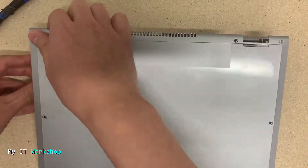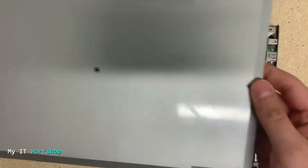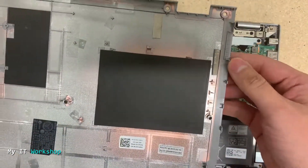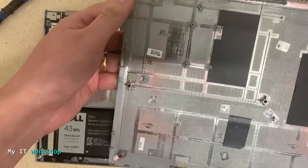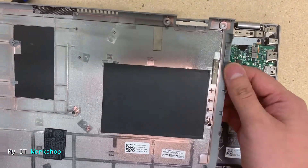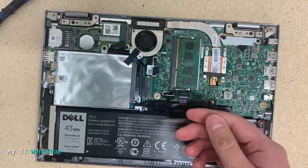And that's how it works. The bottom is magnetic, so that's pretty cool — now you can take it off. The reason I was doing it really slowly is because this kind of model has these clips that I'm pointing to with my thumb. If you break one, that's not such a big deal, but if you break many you might have a problem putting the cover back. So that's why I always say do it very, very slowly.